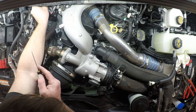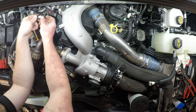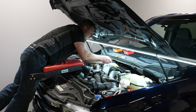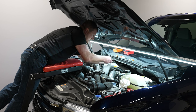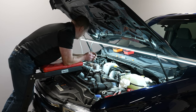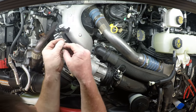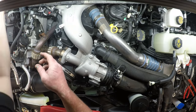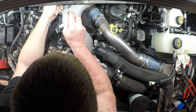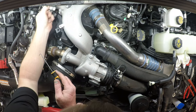There's another connector in the back with a white lock — hit that lock first, then push on the white connector you've unlocked. On this one, the lock is actually the push tab. Additionally, there's another connector underneath for the MAP sensor, but we need to take this shield off to access it — grab an 8mm socket or ratchet wrench to get that removed. Now we can remove the cover over the MAP sensor. Slide the lock back first, then squeeze that lock to release the connector.